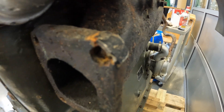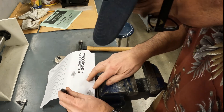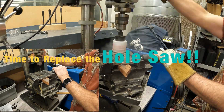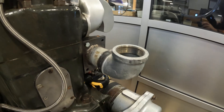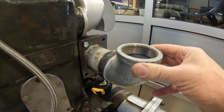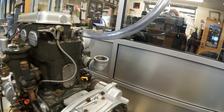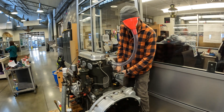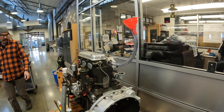The exhaust manifold is pretty rough — it's had a couple of repairs and it's rusty. Sam's planning on getting it replaced; Joe McCool has one that can be shipped over. But we still needed to do something now, so we made a template and used a piece of scrap steel. We decided to build a little flange, weld a two-inch pipe nipple into it, and adapt it to pipe thread hardware. We put a 90-degree elbow on it and bought a three-foot pre-threaded pipe to stick it up in the air. For what we need to do to get her running, that'll be just fine.